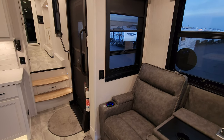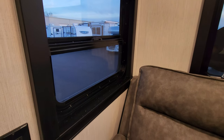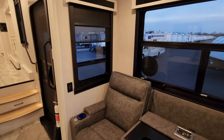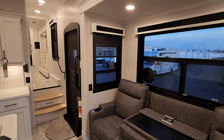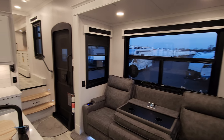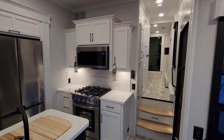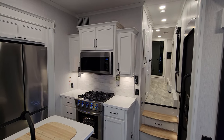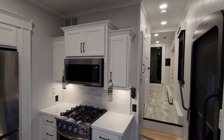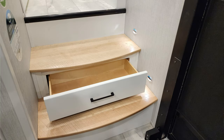There's an electric outlet with USB charger port here. Notice the nice window framework — that is due to the walls being roughly three and a quarter inches thick, where a traditional RV is usually two inches or inch and a half. They use day-night roller shades here. The Riverstone has aluminum-studded fiberglass exterior hung walls, aluminum roof and floor studs, five-eighths tongue-and-groove plywood floor, and half-inch plywood roof decking — thicker than most brands using three-eighths.